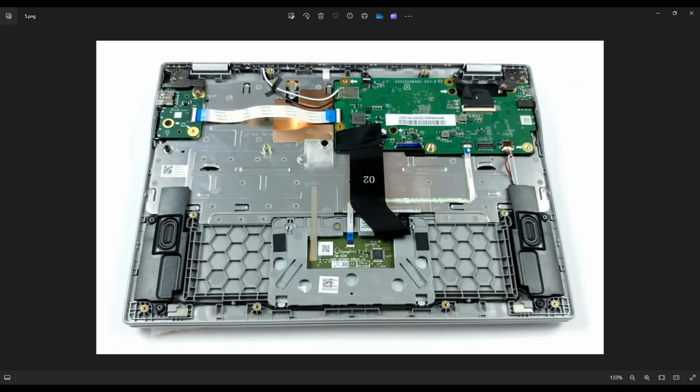To get your motherboard out, you have a screw here and a screw here, and that's it for screws. Again, these screws where these arrows are, those were taken up when we took the bottom case off. So that's how you would get at most of the items in this part of the computer.